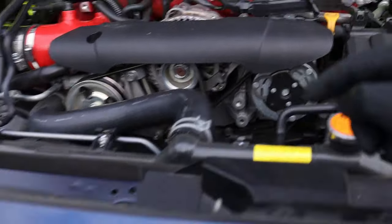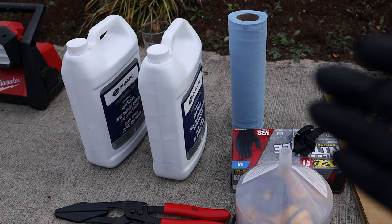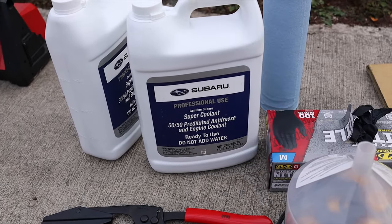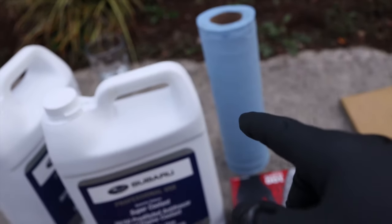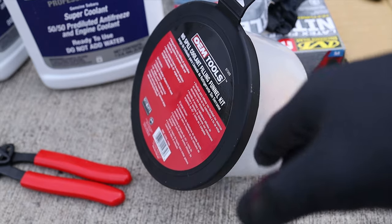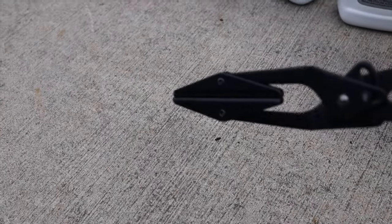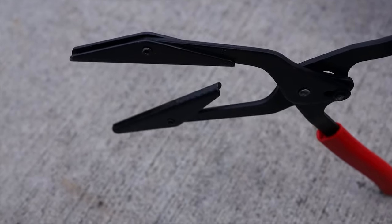The radiator is plugged back up. Keep the coolant reservoir cap off because that's where the coolant is going in. Before filling, here are some things you'll need: coolant, hose pinch pliers, gloves, rags — and I highly recommend a no-spill kit, which makes it super easy to burp your cooling system without leaking everywhere and makes filling a lot easier. First, use the hose pinch pliers to pinch off the cylinder 4 cooling mod hose so no coolant runs through it while we burp the system.